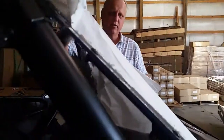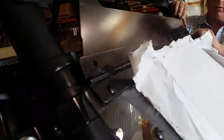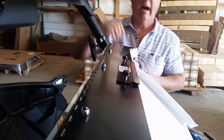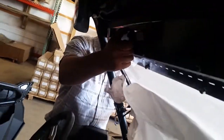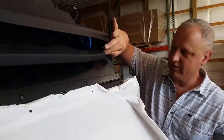Now we've got our hold-open brackets installed to the windshield. There's a driver side and passenger side. We've got our rubber gasket on the bottom, our hinge attached to the glass, and we've left these two bolts off. We've got the top piece bolted to the hinge, and we've put this piece on here loose with a warning label that says: do not operate over five miles an hour with the window in the fully up position. Now we can just slide this up into place and install the visor right back in up here using the Torx screws that you took out.